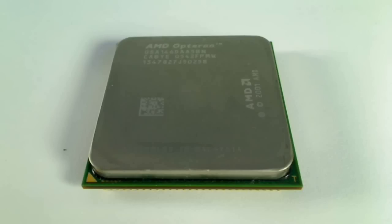The first step to applying the paste is to remove any paste that is already on your CPU. If you've got a brand new CPU it won't come with any paste on it, but I find that nail polish remover and a small cotton bud is the best choice for getting the original paste off. Once you've done that, you'll see that your CPU will look something like this.